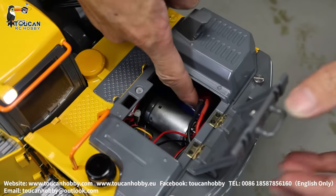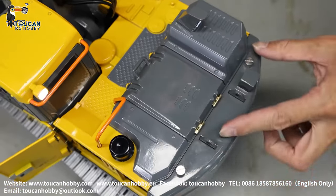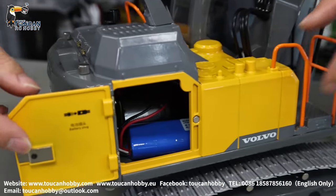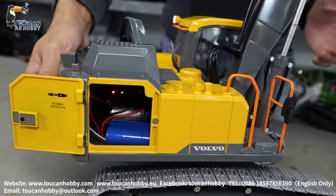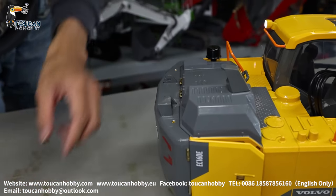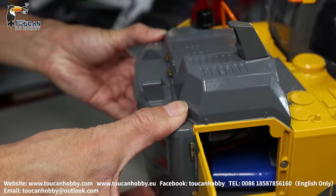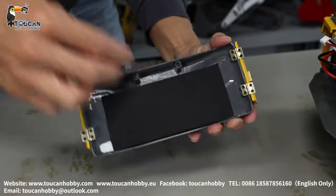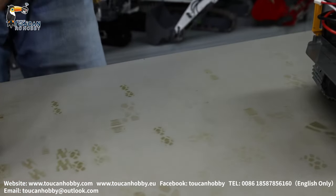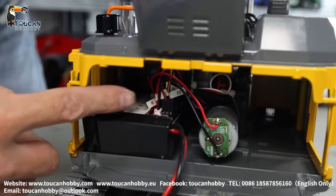The top cover opens — that's the rotation motor. A brushed wire. The rear cover will be opened later. From this position, you can also see the rotation motor and the battery placed in this position. This rear side cover on top has two screws, bottom also has two screws — take out these four. Open the door to the rear side and take out. This is only foam for protection. Inside, that's a metal block — a weight block, it's a heavy one. That's the inside: rotation brush motor, main board, all the control plugs.